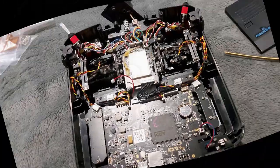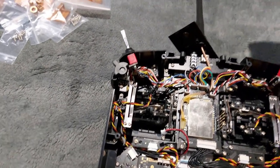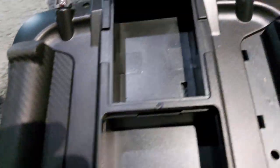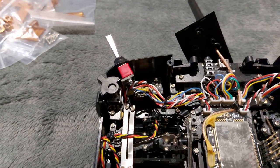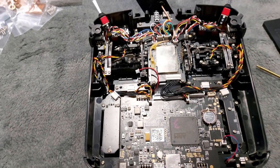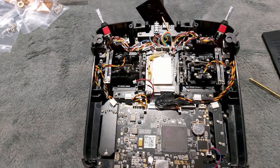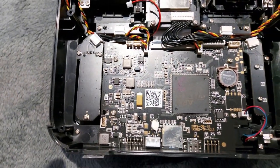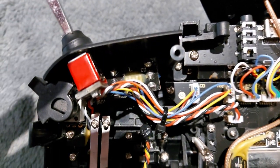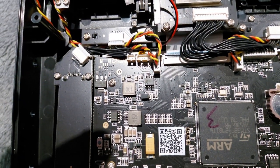The back is off. There are four screws holding the back on — two top mounting screws and two bottom screws — and then it releases the side when you take off these rubber bits. Two screws hold the top piece on as well. Inside there are two wires for your back port — one goes into this cable here and one plugs in here. If you are thinking of doing this, I suggest you take as many pictures as you can. I'm taking pictures at the same time as I'm filming — it gives you less chance of messing up.